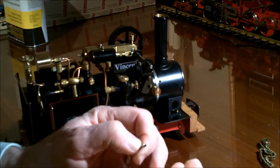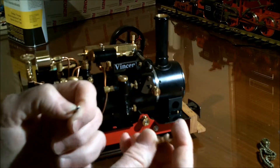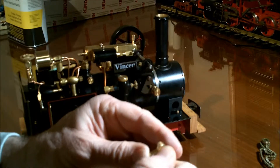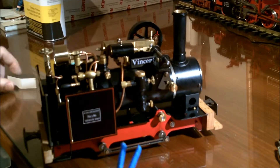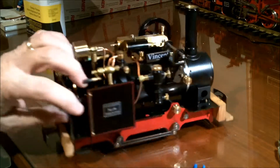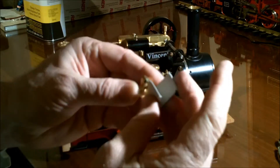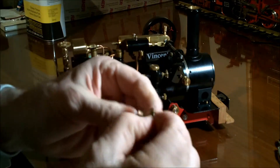You need to make sure you're getting the parts correctly together. This piece has a sort of bushing built into the cheek that goes to the outside, and it's actually like a thrust bearing surface — so make sure it goes in this way. Also, there's another tool I forgot: you need some pliers to grab the pin, but be careful not to damage the bearing surface. Coat your pliers with tape or use a piece of shirt board, or both to be safe.